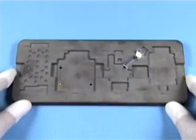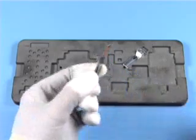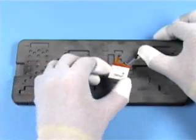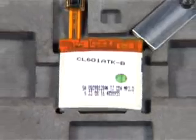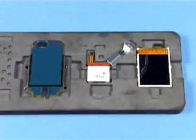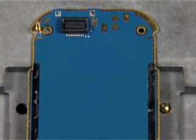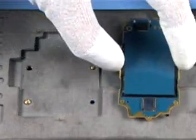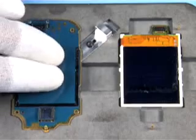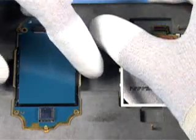Use the SS-104 jig for positioning the displays and gasket correctly. Peel up the protective films from the displays. Place the displays into their compartments as shown. Fit new gaskets on the PWB-1WJ for both displays. Position the PWB to the guides of the jig — both guides must be fitted correctly. Place the PWB over the LCD-PM first, mind the guides, and push it down evenly. Release the lever and remove the PWB.